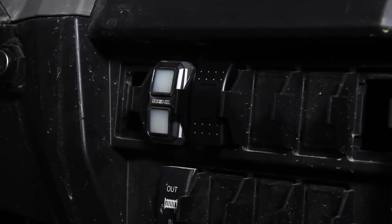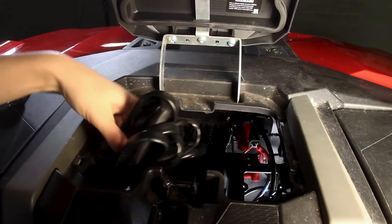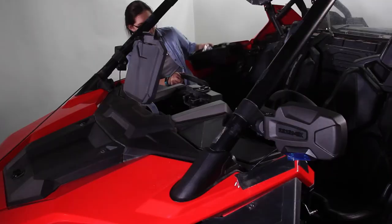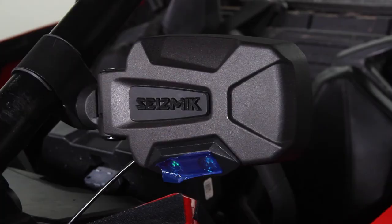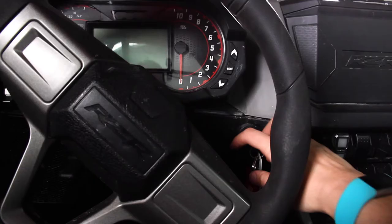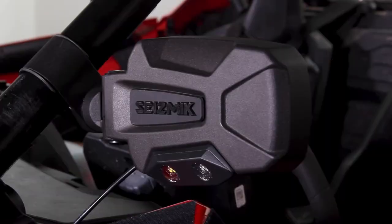Make sure you've secured any remaining wiring before considering yourself done. You can zip tie your wires to other non-moving components of the vehicle. Now close up your pulse bar area. Reconnect your battery, flip the switch, and see what happens. Middle position will be off and the up and down positions will be either white or green.